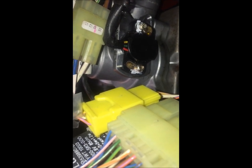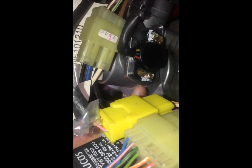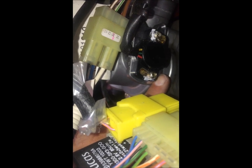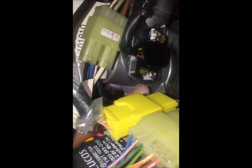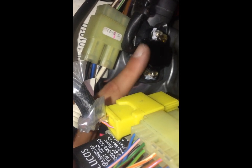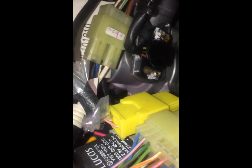I've just adjusted the two screws and I'm going to keep going until I get this right. This could take a while, but so far the whole job has taken about 30 minutes while doing these video bits at the same time - it's no mammoth task. All I'm doing is releasing the two screws and pushing it just a little bit that way, or a little bit back the other way if needed. You're just moving it one millimeter at a time. Because both are released, the top bit moves and the bottom bit moves - just make sure you've got plenty of glue scraped out so you can push it.